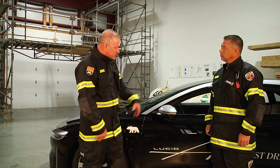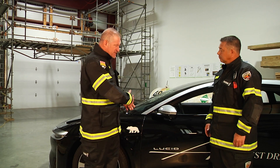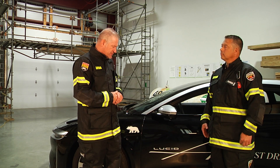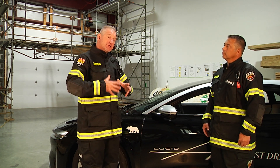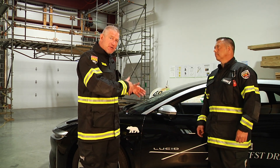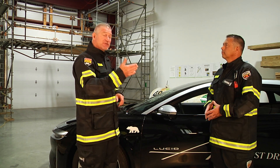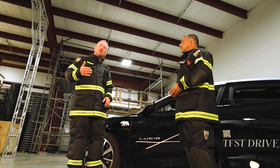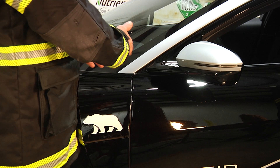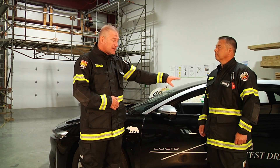The alternate approach to create these gaps is to do window spreads that Jason is going to discuss. Once these gaps are open and we start deciding whether we're going to attack latches or hinges on these cars, remember that with electric vehicles there are different metals and different body construction. The interior and exterior door skins on modern EVs are very hard and very brittle.